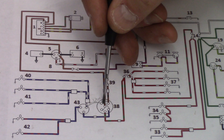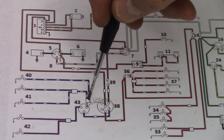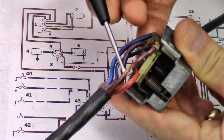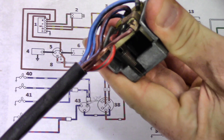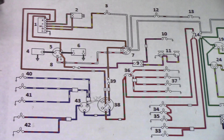The diagram shows it should be a brown with a black tracer wire, but it's just straight brown. When you pull that column switch back to flash the high beams, that's what closes the little switch — it comes down and touches the two top contacts, creating a short across that switch. Then the undocumented wire goes right into the foot switch and is directly connected to the high beam. That's how the high beam flash works — the key question I had is now figured out.